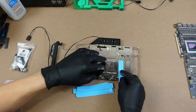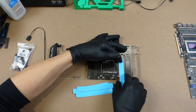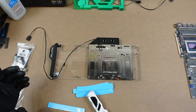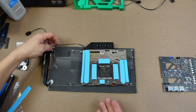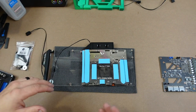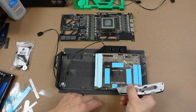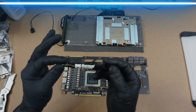We have the thermal pads. I'm going to hold the actual unit, take my knife, and just mark where it is. I'm totally removing these gloves for this. So the front water block — now that you have everything cut to size where all the thermal pads need to go, you need to peel them and stick them. That's what I'm going to do right now. This is literally the absolute worst part — this is what people trying to thread a needle feel like.